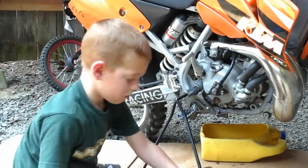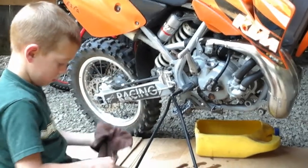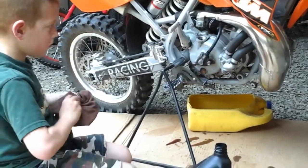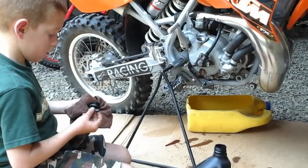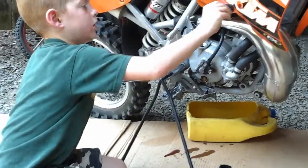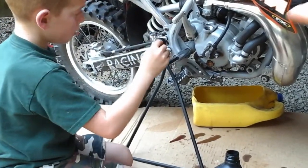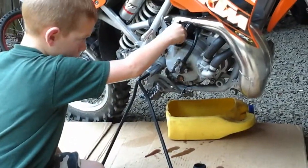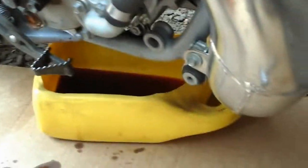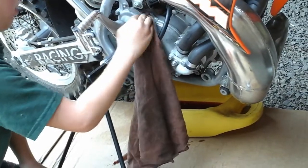Wipe your part on your crankcase first. And where it goes into the motor, wipe that dirt off around it — don't wipe it inside though. Up here where your hole is on the motor, wipe it around like this. Wipe the dirt off the crank, wipe the dirt off the motor right here. Clean that up real good with your rag — that way it seals nice.